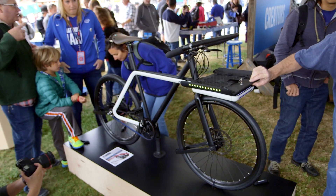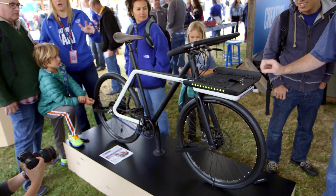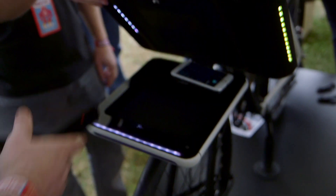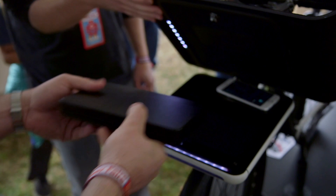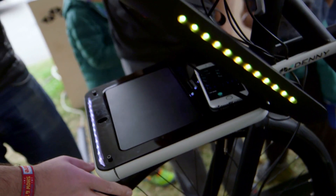It brings all the systems together and integrates with the e-assist hub to give us power meter stats — how much energy you're exerting, how far you've traveled. There's a high-volt and a low-volt power system. The high-volt is our 36-volt removable rechargeable LiPo that powers just the rear motor — it's removable so when you get to work you can take it with you and top it off as needed. All of our lights and components are powered off a 5-volt front dynamo, so your lights and the brain of the bike are always active and ready.